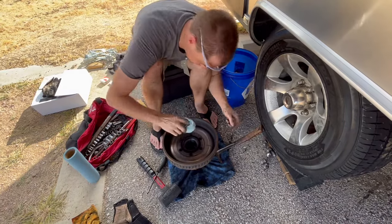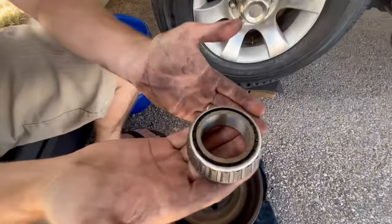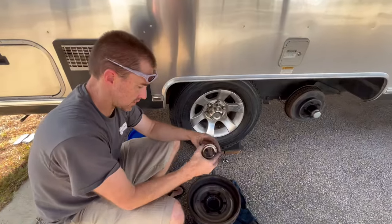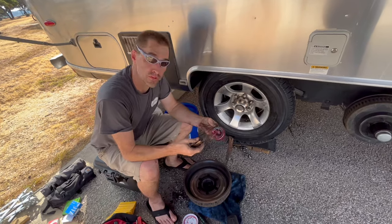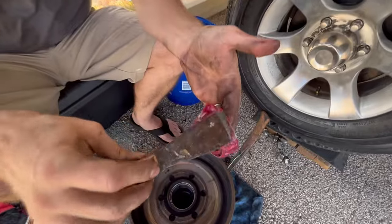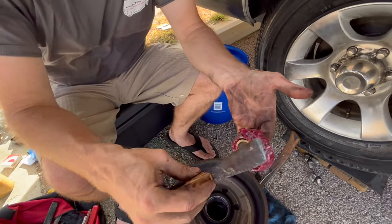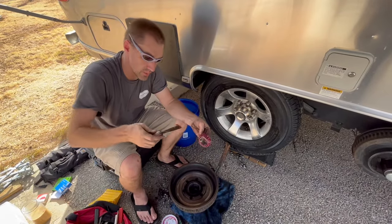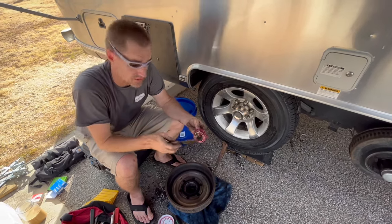Final wipe to get any brake dust off the bearing surfaces on the inside. This is the larger of the two wheel bearings — the inner one. I'm going to pack it with grease and slip it into the back side of the drum. The most important thing when repacking bearings is to be careful not to contaminate them with any sand or little rocks. I keep catching debris on a tool and I don't want to put that into the grease and bearing surfaces.